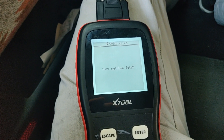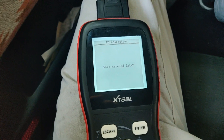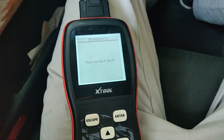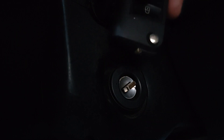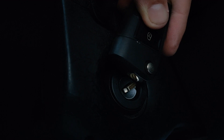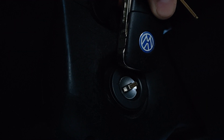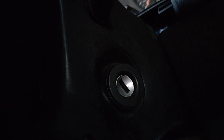Once you're done, turn the car off, remove the key, unplug the scan tool, and test each key individually. I'm going to use the broken key first — there's the key next to the key ring. Hit enter for save match data. The immobilizer light should go off pretty quickly. Power cycle the car, bring the next key up, do that until the immobilizer goes out again, then power cycle off, remove the key, remove the scan tool, and use each key to confirm.